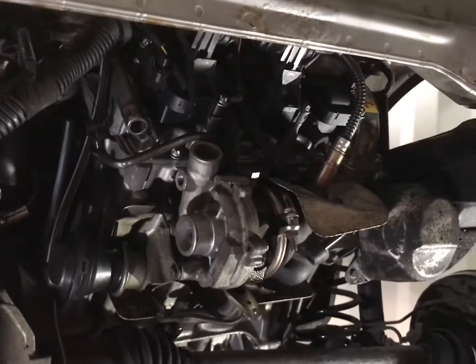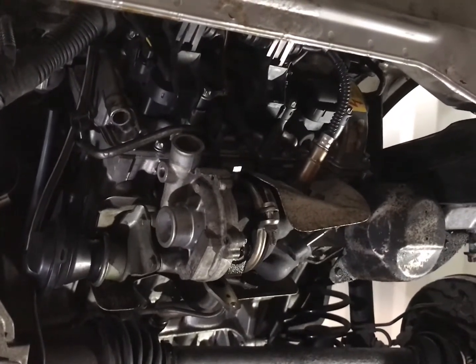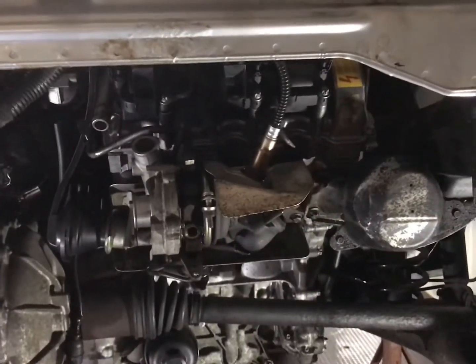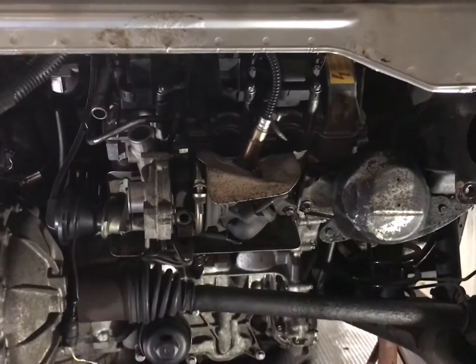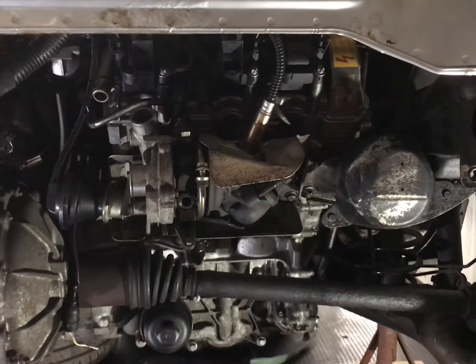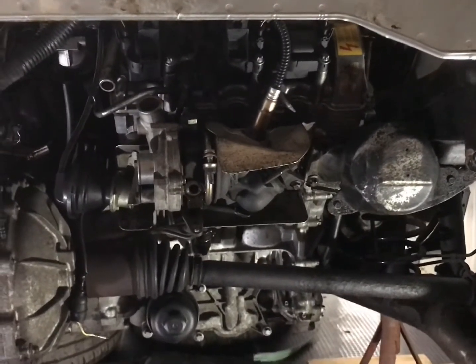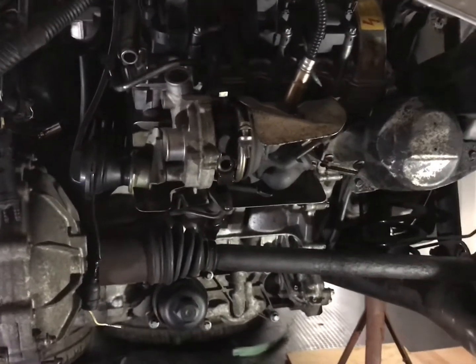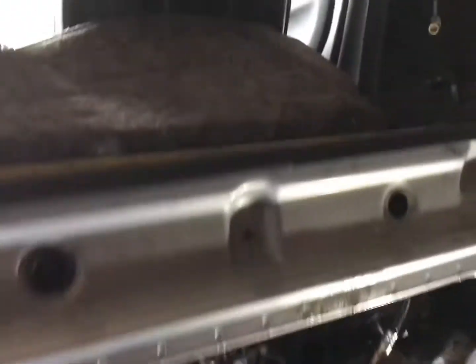The engine was cleaned out and new bearings, new shells. Head was all cleaned out, new valves and everything, because as you may remember, we had two valves burnt out, and we thought we better check the rest of the engine. And it was lucky because the oil control rings on the pistons were really gunged up and stuck, and according to the interweb, that can be a very good reason why the valves burnt out.